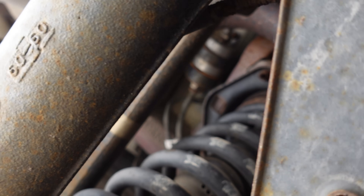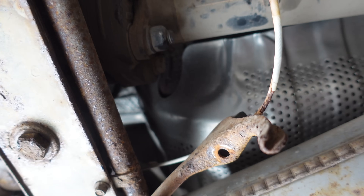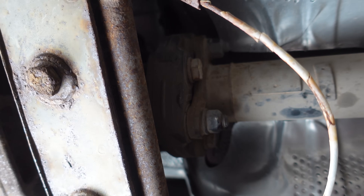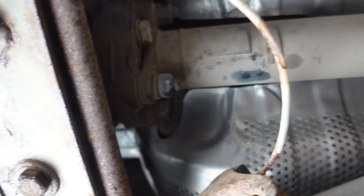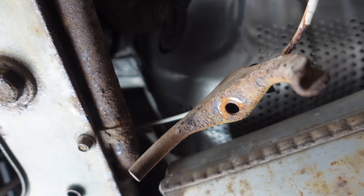The fuel filter is right there up above the spring — that's actually not a big deal — but everything else is an absolute nightmare to get to. I even had to disconnect the e-brake just so I could get my arm through the little gap between the driveshaft and the exhaust. And of course doing that, the bolt broke. So we're going to have to extend the bolt just so we can put it back together.